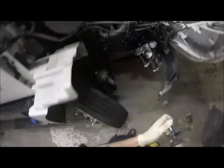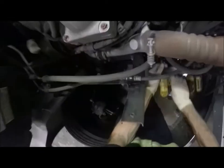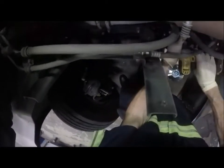It's okay. All right, so before I get too crazy with myself, I need to put these two nuts back onto the radiator support bracket. Now they use these things which kind of grab on the edges, kind of like a Nord lock, but not exactly a Nord lock. All right, we're gonna drop that on there. Now we're gonna take our shield, let's put that back in here. I believe that goes over the top of this into here. Just like that. There we go.